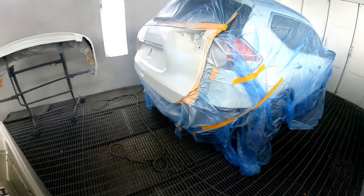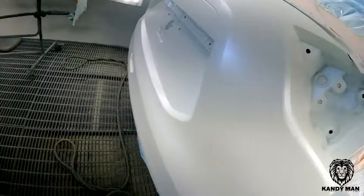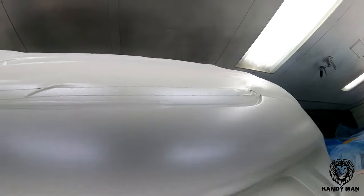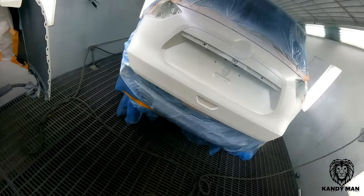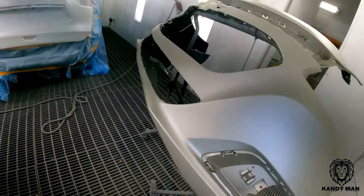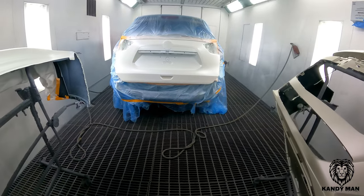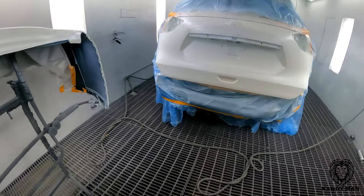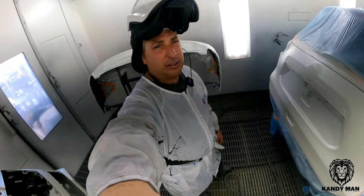Alright guys, I'm over here on this side also working two jobs — 102V and QAB three-stage. New bumper, fine line, raw — make sure you get the tape time and raw prep time, and anything else you can figure out. We've got two colors in here to maximize this booth. This one's all flashed off and I'm getting ready to clear it. I'm going to clear this one, hit bake, and then I'll be back over there finishing that one up and hitting bake.